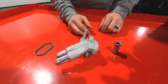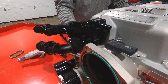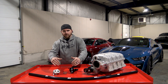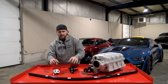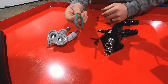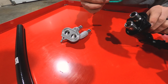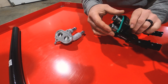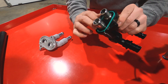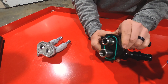I'm going to go ahead and pull this off here and then we'll pick back up and show you the back side of our manifold. Now that we have the water manifold off, we're going to go over it from the rear side so you can see the adapter fittings and what we've got going on. One of the main things to start with is the gasket — we actually use the factory gasket. If you need to replace it down the road it's very simple; it's not a custom o-ring, so you can transfer it right over or replace it with a factory part, which is convenient.